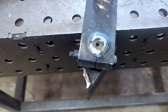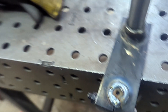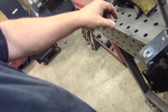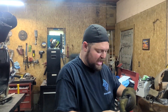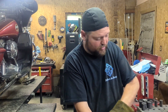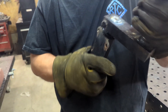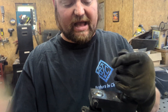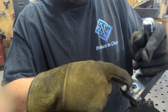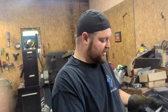This is the shaft and this is what we weld up right here. Because it's a little hot — I just got done welding it — you've seen how it moved before. Now if you watch it, she can't move. It's solid. So this is a normal axle now, which is fine because it's already been set. It's not adjustable anymore, but it's just like a regular axle. That's how you weld it up: put three tacks on the back and then weld that front key all the way up. Now she's just like any other axle. That's how you fix it.